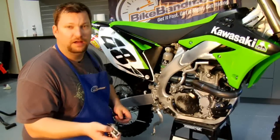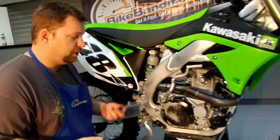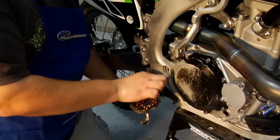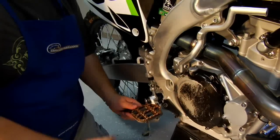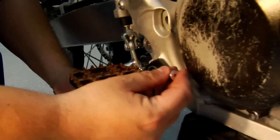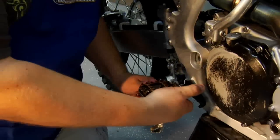I've got the peg off and the spring for the right side already lined up. Install onto the frame. A trick that I like to use is to get a screwdriver and you line yourself up all the way through the pin, through the spring, and then through the other side. So now it keeps everything in line and you simply feed the pin in while removing the screwdriver.